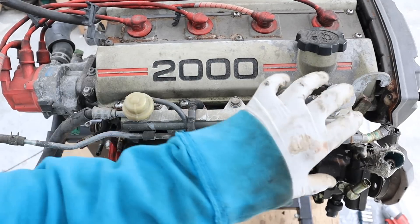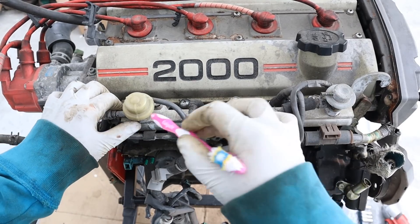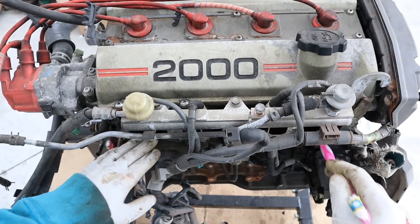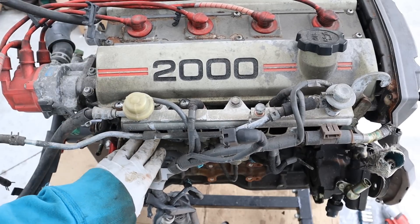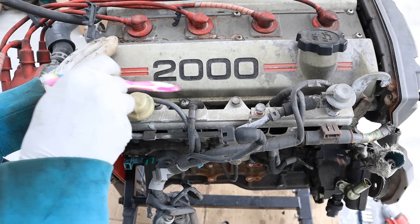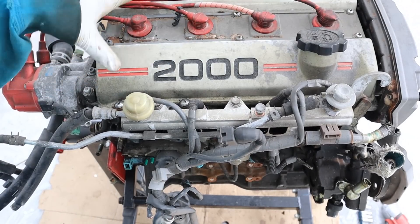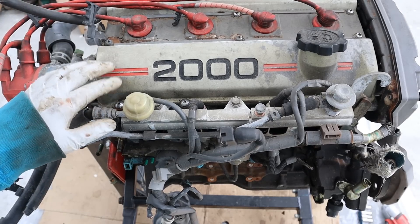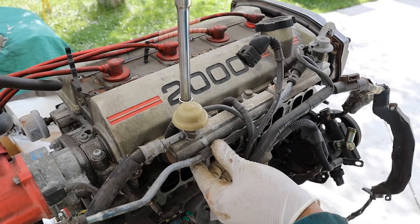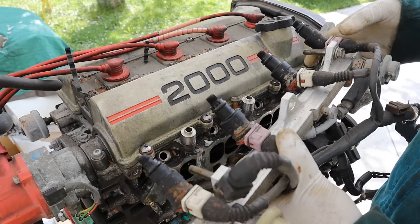With the air intake out of the way, you can see this is one of the later models of 3S engines that have fuel injection. This is your injection rail over here — it's port injected directly down into the intake runners, with one injector per cylinder that has to serve both runners. Also notable is that the valve cover gasket is super simple to change: it's just Phillips bolts that go all the way around, about 8 of them. I'll go ahead and remove the 12mm bolts for the fuel rail and then remove the fuel rail with the 4 injectors.